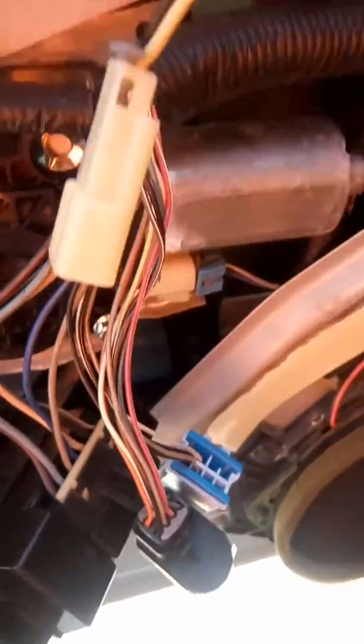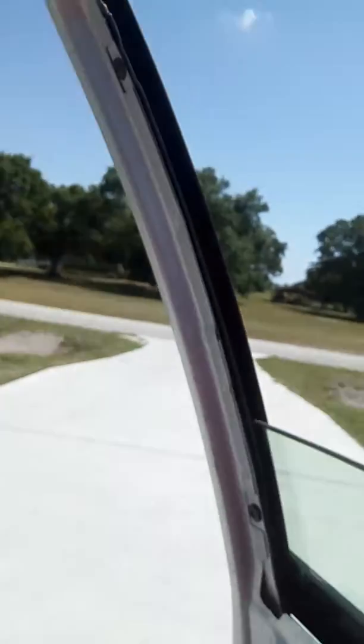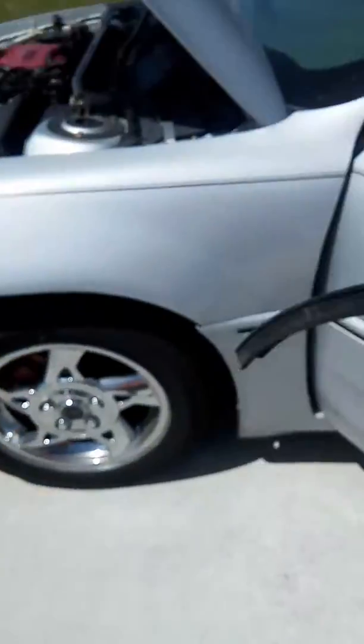Make sure that when you go to put the rubber piece back in, there's usually a separate rubber piece on this side down in the bottom. I found it laying down in the bottom and slid it up here to help guide the window in place on the back side, facing the rear of the car. I'm going to spray it down with silicone and work this thing back in — starting with the front side first, which is what I took out first.